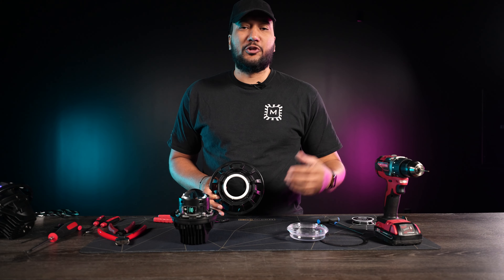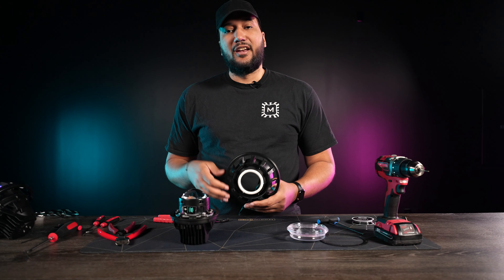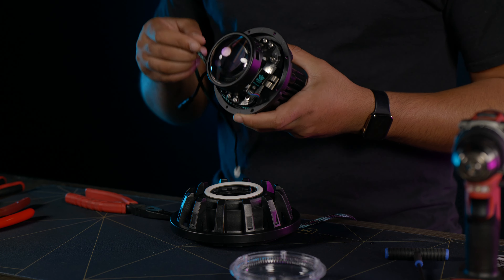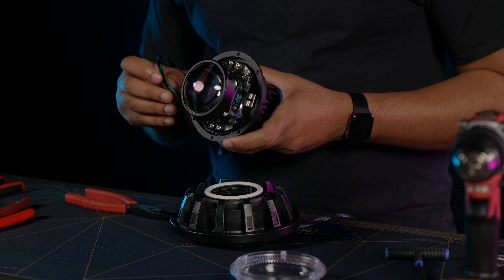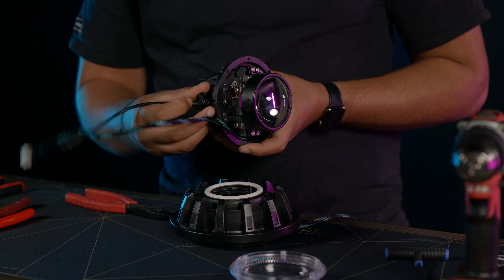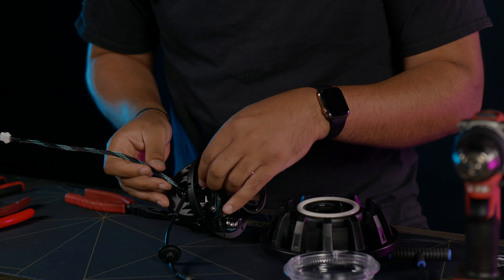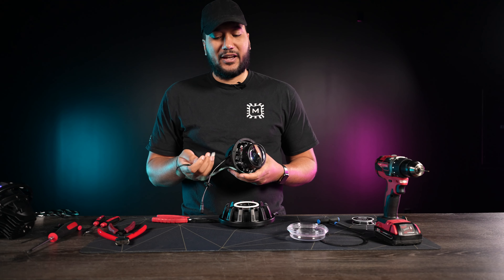Make sure this ring light is snug so it's not vibrating while driving. Next, I'm going to wire tuck these around the projector to make sure the wires don't get in the way of any moving parts. This is LED, so the projector flap is way on the inside — the likelihood of hitting anything is very low. What we did was tuck this in all the way through. There's a grommet on the other side that you'll have to pop out. Don't worry about getting the wire all the way through the grommet right now — we can save that for last. Just make sure it gets tucked and the excess is pushed through.